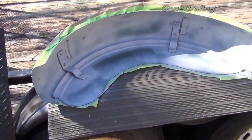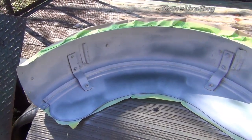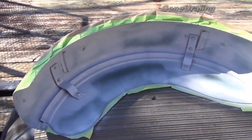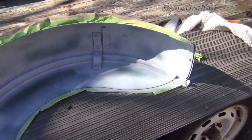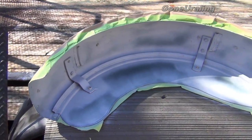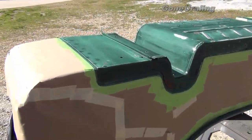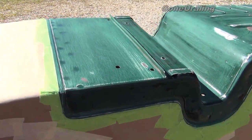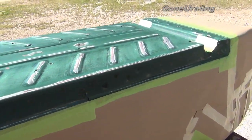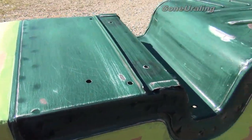Since I have the fender off, I decided I'm gonna go ahead and put bed liner under it too. We've sanded it down to the point nothing's flaking. I've hit it with the bare metal primer and I'll also use some of the adhesion promoter under here around the edges — hopefully that'll work, figure it can't hurt. We have the bottom of the Patrol sidecar prepped up, ready to prime, with adhesion promoter around the edges, and have it ready.